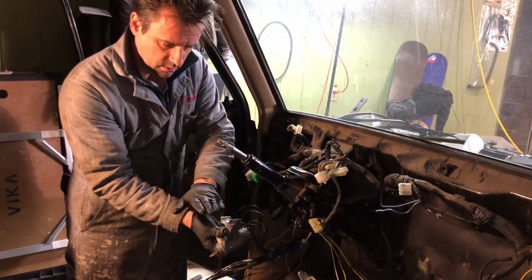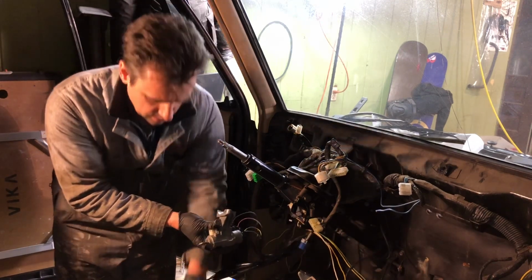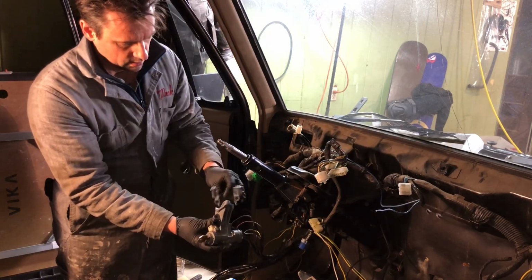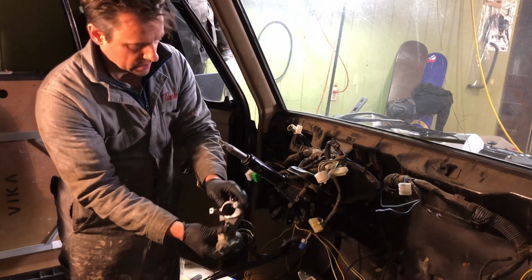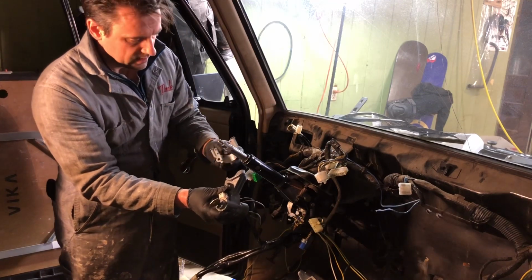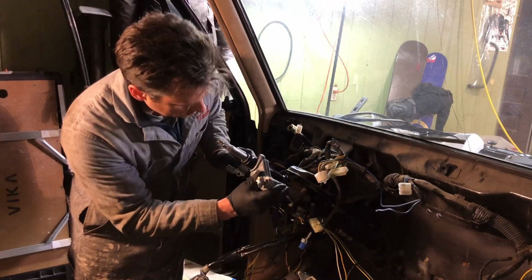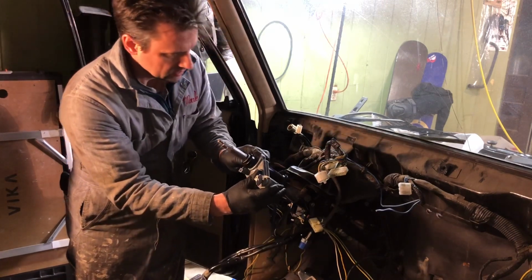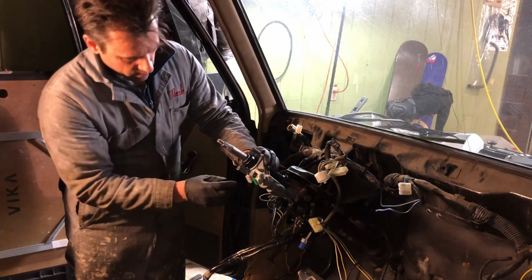You can grind a little bit of surface off of where those two come together, and come up with a smaller circumference there to grab that steering column. And I can't find any information on this design, so I don't think there's a reason why it needs to be loose like that. When these things are clamped together, it's a little bit loose.